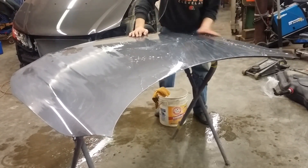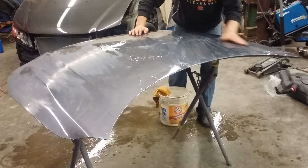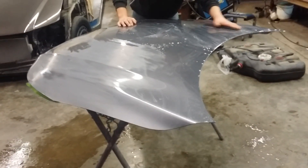Here I got my man, Roman. He's sanding with 2,000 grit with soap and water. You want to go ahead and sand it flat to something like this. And as I'm going to show you, there are still a couple more dust specs in the top clear coat, which will be sanded out completely.